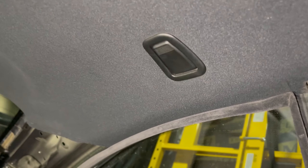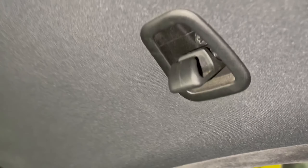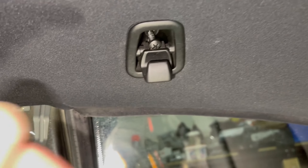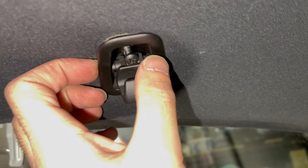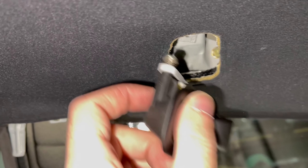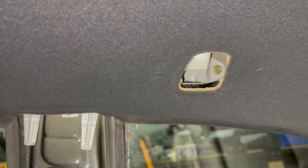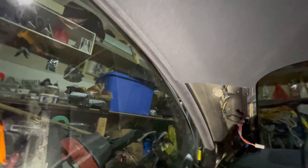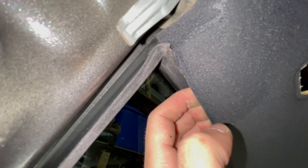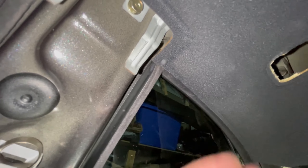The last thing is to pull out the coat hangers. Press in on it — it opens up and there's one Phillips screw in there to undo. Once the screw is loose, pull it from one side, since the whole other side is for the mechanism. Always pull it towards the inside of the car. Now get all the edges of the headliner out from the weather strips — just pull a little bit and make sure it slips out of the weather strip all the way around.